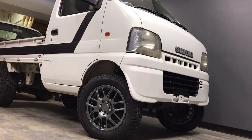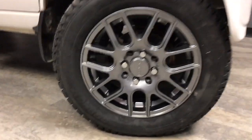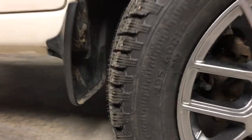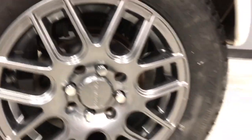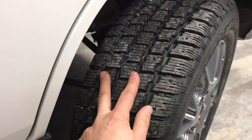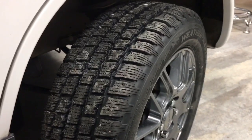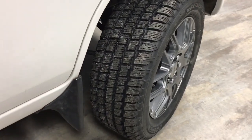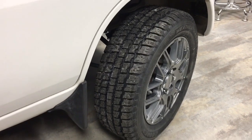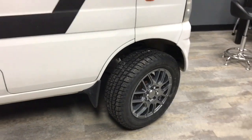As far as upgrades on this truck, we did the 2-inch lift kit, as well as 14-inch Vision alloy wheels in a gunmetal finish, with a set of 195/60R14 Cooper ST2 studded snow radials. It's a nice grippy tread with a soft compound tire, and that's why we usually go with a winter tire for a street/off-road setup — they have a softer compound and better tread. In this tire size in Canada, that's about as aggressive as we can find that's still fully street legal.